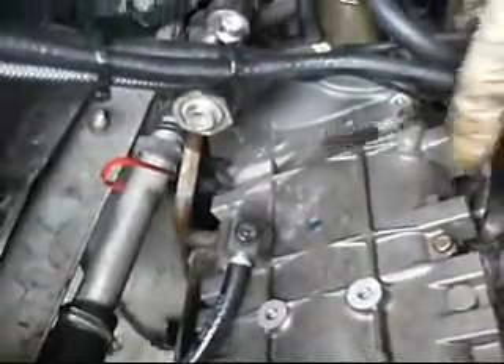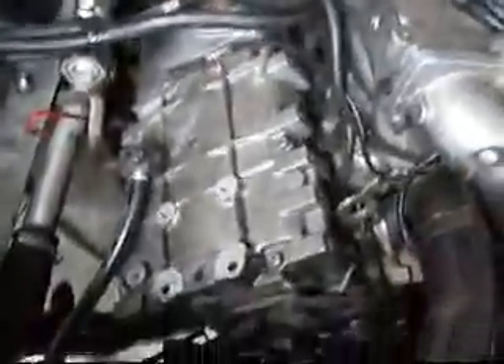Take the compressor out — you've got this little wire, you disconnect that, and then there's actually just four bolts: one, two, three, four. Compressor comes out. You can lift it out at an angle because of the belt, which is helpful when the adjusting bolt is frozen in place and the muffler's kind of affecting access to it.